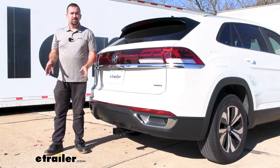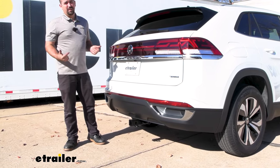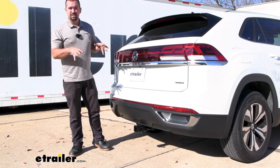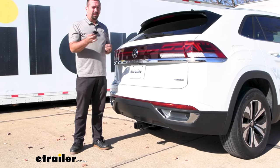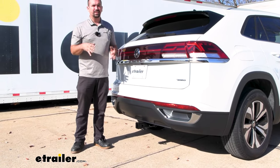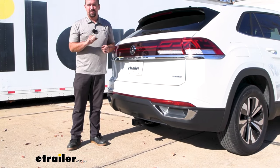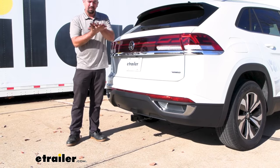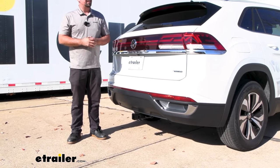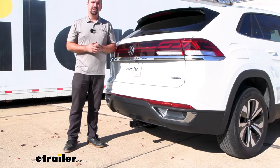As far as installation goes, this one's not too terribly hard to do. You're going to be fish-wiring hardware into the frame rail, but you do need to lower down the muffler, which is really easy on this one. It does get a little bit tight feeding everything up, and especially on the driver's side there's one bolt that's just kind of tricky and out of the way. You're also going to have to scrape away some of the frame caulk from the factory just to get that nice tight flush fit — so it's a little tedious, but overall step by step it's not too hard. I'm going to walk you through all those steps so let's take a look at that install.